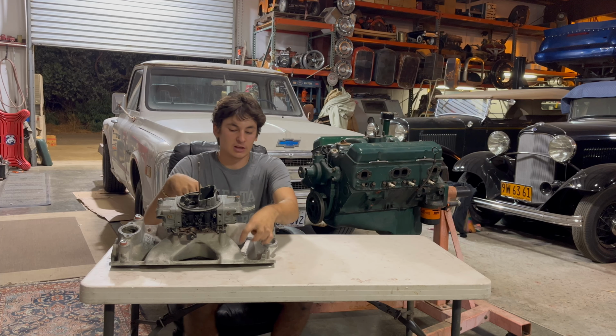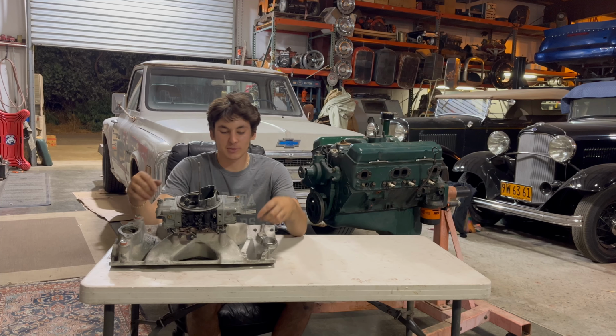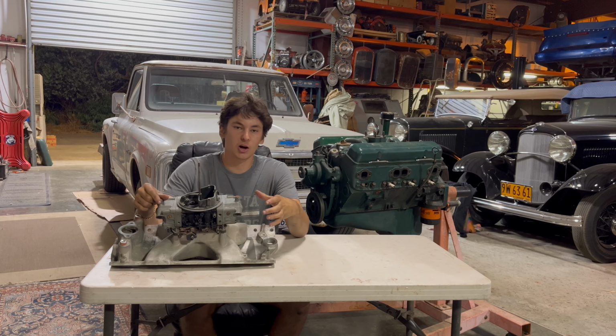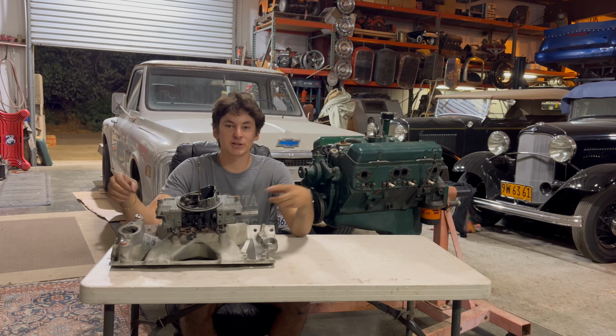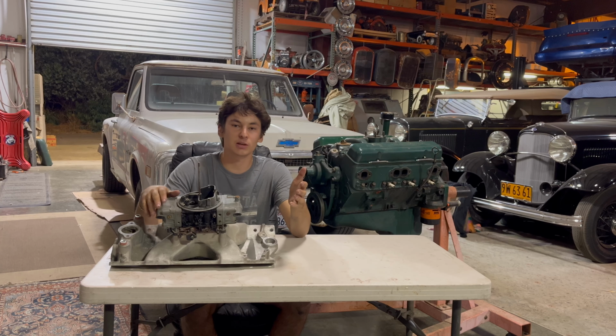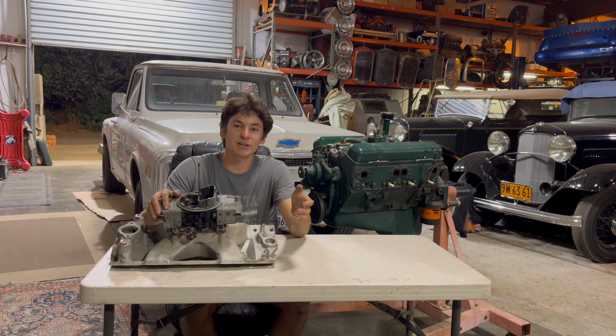That can be injectors into the ports. I don't know if a carburetor plate can be a dry system. I think it's just injectors into the ports. And you're compensating for that extra oxygen in your tune-up, meaning there's no fuel solenoid, you're only spraying nitrous into the engine, and it's on you to make up for that extra oxygen in your tune-up with EFI. I don't believe you can even run a dry system with a carburetor. So that's kind of your basic nitrous 101.